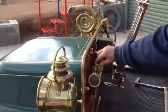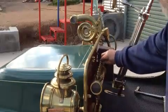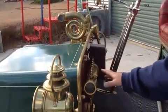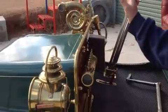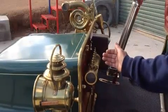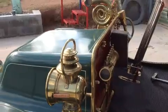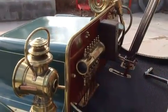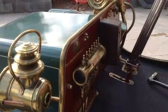These are the actual drips. There are 7 of them, and they are timed at somewhere between 4 and 12 drips per minute, and they go to the big ends, the main bearings, the bearing on the other end of the crankshaft for the transmission. They also oil the push rods for exhaust and inlet.